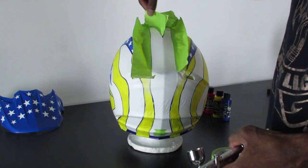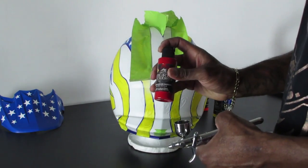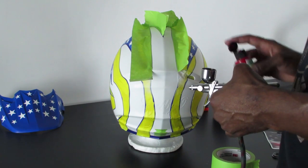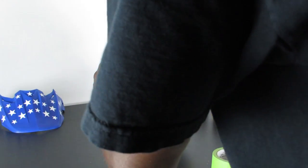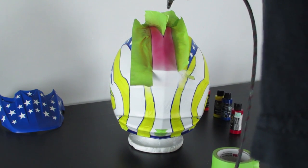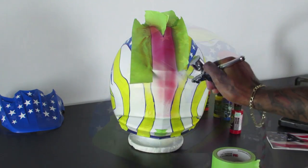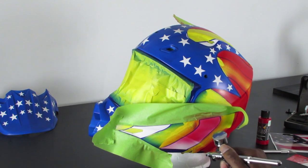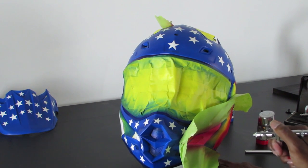Now we want to paint in our red stripes and we're going to do a reverse shield on this. We start one stripe at a time, only taping off what's necessary, but you still have to be careful not to overshoot your tape. Keep that shield on there and work one stripe until it's totally solid the way you want it — starting with that dust layer first, then going right back over it until you have a solid. Don't try to do it all at once; paint only the area you need to, so you don't leave tape on the paint job too long and risk pulling up paint.